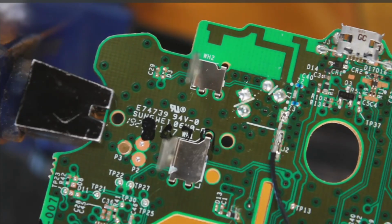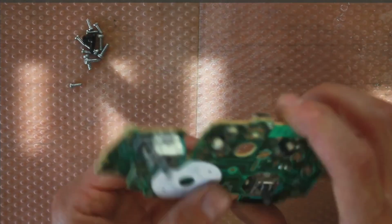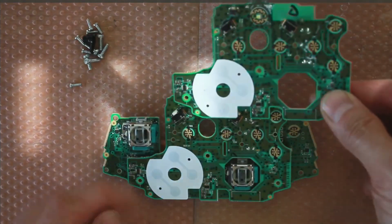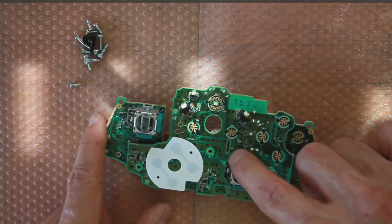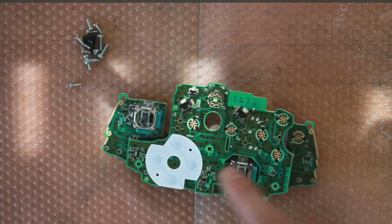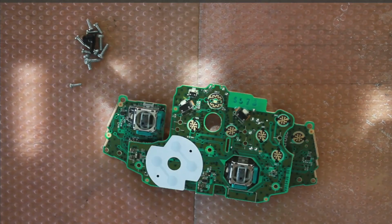What I'm going to do is just connect this up again to Windows and see if that solved the problem. So I've got this partially assembled. I've just put the two logic boards together. Remember, this was the donor board. Put that aside, I won't actually need that. I soldered a link wire through the hole because I got continuity between this point and TP25 on the other side. I should be okay.